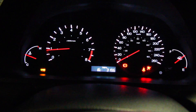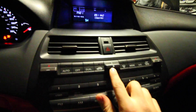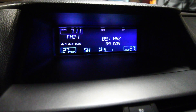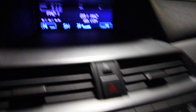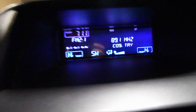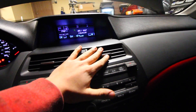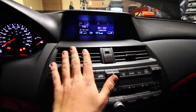You can see on the gauge on the left for coolant temperature that it's up to operating temperature. To get all the coolant to circulate inside the heater core, we move to our HVAC system and turn it up — temperature set on high, fan speed cranked up as much as it can go, and mode set to blow as hot as possible on the inside. Full blast, high temperature, blowing on the face vents and lower vents by your feet. Once we do this, we're going to allow this to circulate until we get nice warm hot air through the heater — and right away we can already feel it, which means the coolant is circulating nicely and everything should be good to go.